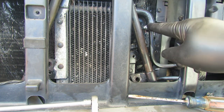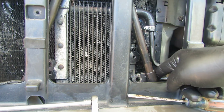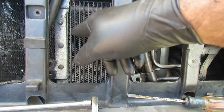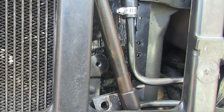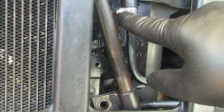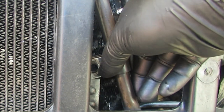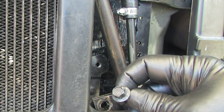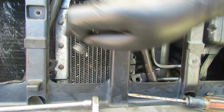I got all the new hose lines — cooler lines — and all the new hose clamps in place. The one down there got in place too; it wasn't too bad, you just had to finagle it back and forth to get the hoses and hose clamps to line up. Now all I've got to do is go back with these — these are quarter-inch head on these hose clamps, though yours could be different. The 10 millimeter head bolts hold everything back together — one at the top, one here, and one here.